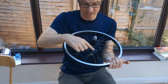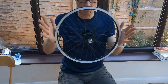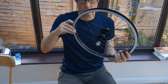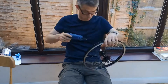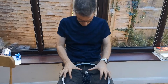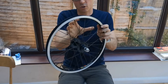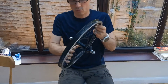Now with all the spokes in, you can see that every one crosses over two spokes — one close to the hub and one further up. We have a wheel in which everything crosses two spokes. I'm now going to trim it up using the electric screwdriver and the nipple driver, and then from there we'll deal with the compatibility problems. I've given it an initial go but some of the spokes are much tighter than others, so I'm going to give them a bit of a stretch and see if that makes a difference, then put it in the wheel jig.